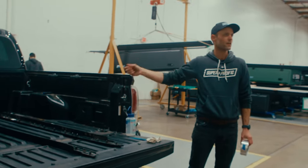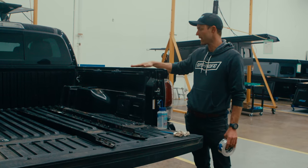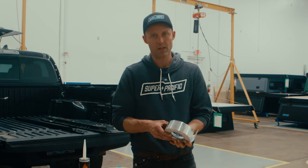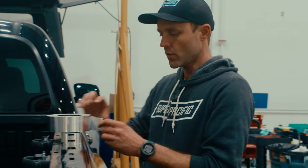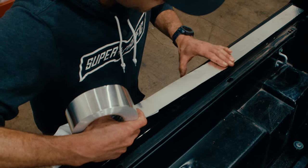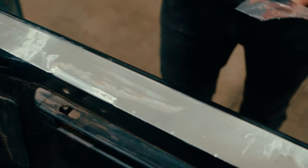The goal is to close these holes with something that all the clips can pass through again and create a seal around each clip, to keep dust from coming up from between the truck bed and the truck body and working its way between that plastic cap. Material-wise, this is just HVAC foil tape — you can get it at any hardware store. This one is made by Tape Plus, which is probably the generic version of a 3M product. It's a foil tape with a peel-off backer. That is mostly a barrier against dust.